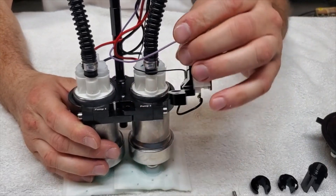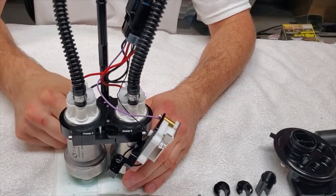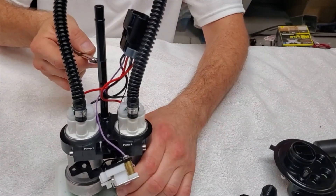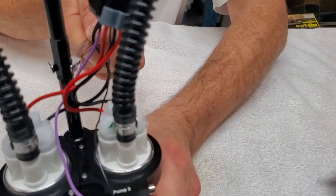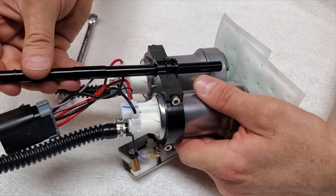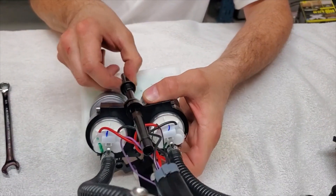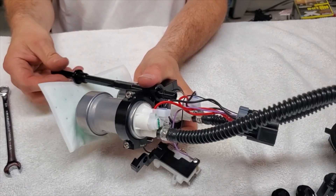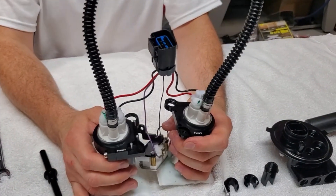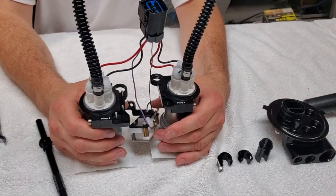Finally, the last stage is to loosen the return mounting shaft, which will allow you to separate the two pumps for assembly inside the tank. For that, we need a 3/8 open-end wrench. Rotate it in this direction and you can see it will unthread from the brackets. Remove the shaft by sliding it down. Now you have two separate pumps and a bracket that you will install in the tank in sequence and then reassemble everything in the opposite order that we dismantled it.